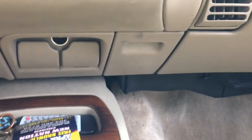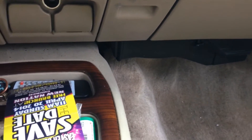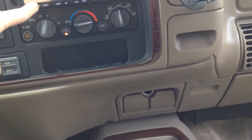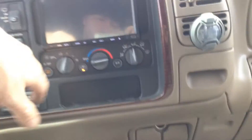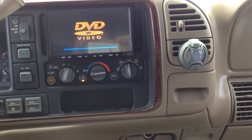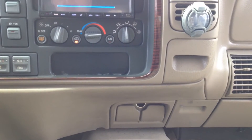To add an extra touch of class I found some black light LEDs right there where your feet are. I used a momentary switch connected to a latching relay on the radio's auto antenna wire. That way, as long as the stereo is on the lights will stay on as soon as you hit the switch, and they shut off as soon as the radio turns off — so you can turn it off with the key or just by turning the stereo off.